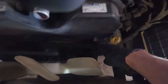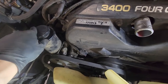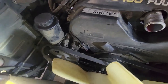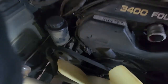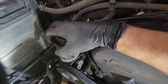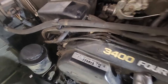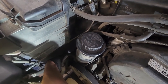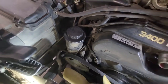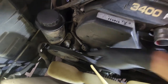So I got the alternator belt tight. So now we need to do a power steering belt. The AC belt we'll do from the bottom. I was gonna show you how I tighten this, because it's hard to get a ratchet or a wrench on the back side on that adjuster bolt. As long as you clean that adjuster bolt, what I do is lay your arm across the top of the cover right here and just give it a good old pull like that. And you can use that hand to pull and use your other hand down here to turn the adjuster and just really reef on this and then tighten that adjuster back there. And you can usually get it tight enough by hand without using any wrenches besides your lock bolt and nut.